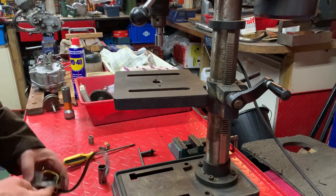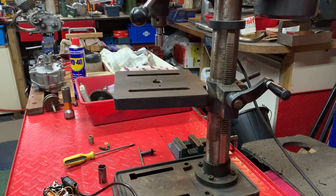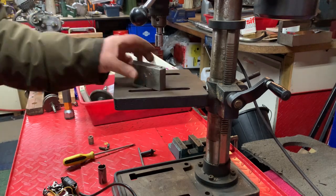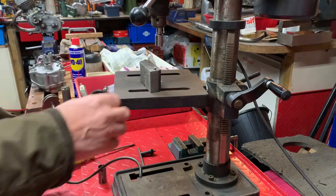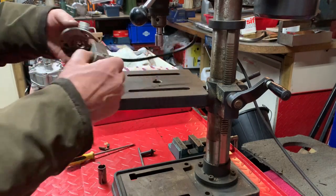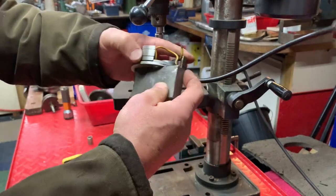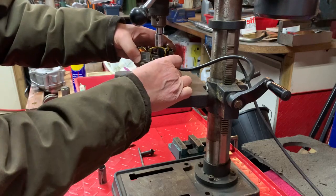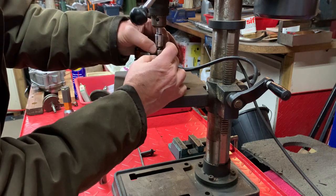I'm going to put the new one in. For the new one I've forgotten to get a little tool out of my toolbox. It's basically a square block — well, it's a piece of steel, an old propeller weight actually. So you're going to make sure you're sitting on — not the wire — just sit on this plate here nice and square, and get your new condenser and hold it as square as you can.